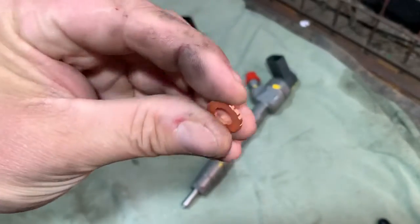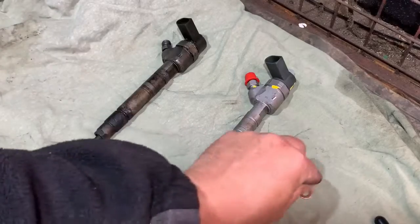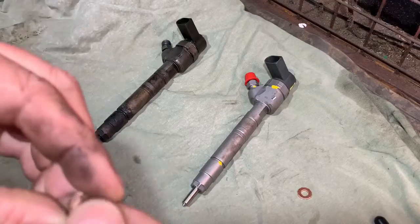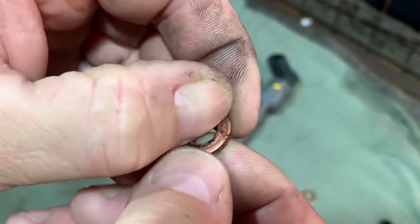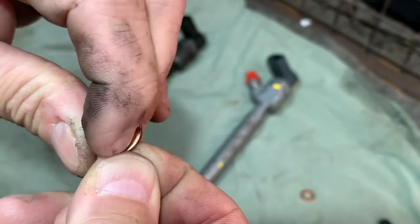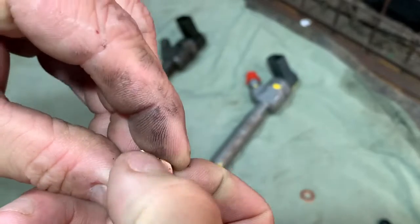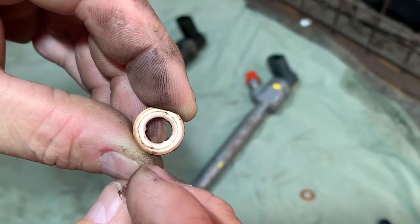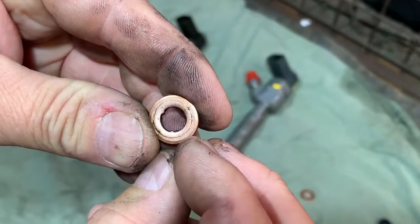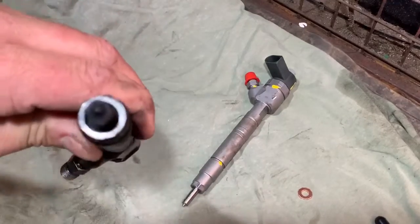I'm going to still stick with the Honda ones I've had good success with, even though one was wasted on that injector. Where is that one? There it is. I can see it's sort of sealed on there a bit, but I think that was the part that was against the injector. You can see it's not sealed so much this side, and seems to be okay underneath. So I think that's my problem. I just think that end of that injector where it seals is worn.